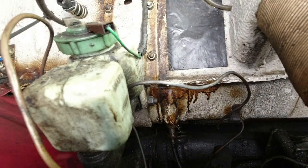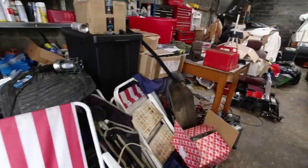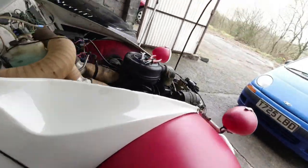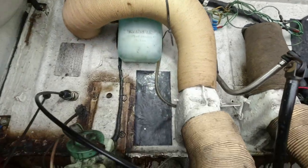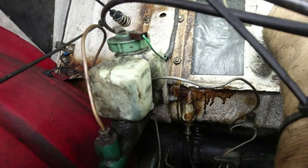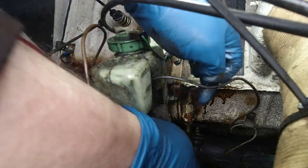Let's put that back on and go and have another look. Fun, this job isn't it? It's one of those jobs where it's nice to have an assistant. Check the pedal — now that's too much, we've got no free play at all, and that was starting to operate the clutch. That's a tiny little bit of free play — I would like a little more.